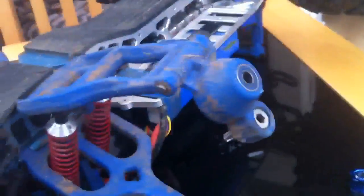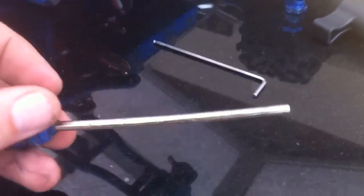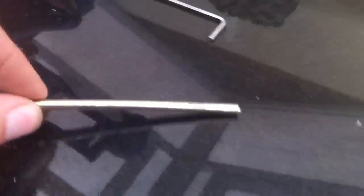So a bit premature to what I was planning anyway, I'm going to have to fit my new MIP CVDs just a bit earlier before I got my FLM chassis fixed, as these really poor crappy Traxxas drive shafts have snapped. You can see the thing looks like a banana — it's absolutely bent. I keep straightening it up and bending it back, they're so weak it's a joke. So I'm just going to fit these MIPs on now and we'll see what they compare like.